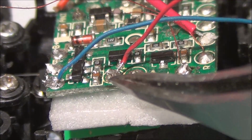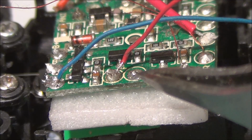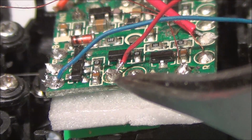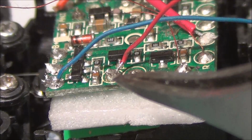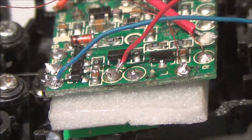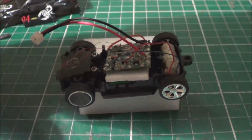There's two pads here for the positive wire on the motor. Now both these pads work. This pad on the right here, I've found that it will give you the 2-speed function with more power, and it works fine. But I've also found that this one on the left here gives you the same normal stick speed, but when you push the boost button, it gives you everything that's in the battery basically to the motor. When you hit it, it's just all the power at once. You can definitely tell the difference. I'll just zoom back, plug in a battery and show you what I mean.